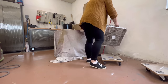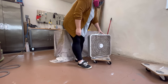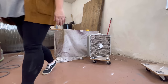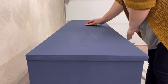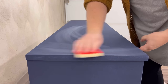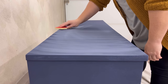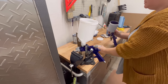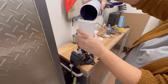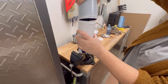I turned on my box fan to keep the air moving out in the garage and help the paint dry for about two hours. When it was dry I did need to go back over everything with some more 400 grit sandpaper to smooth it out and fix all of that splattered texture. In the interest of time I decided to just swap guns, poured my paint into a backup gun, and then continued on with my second coat.